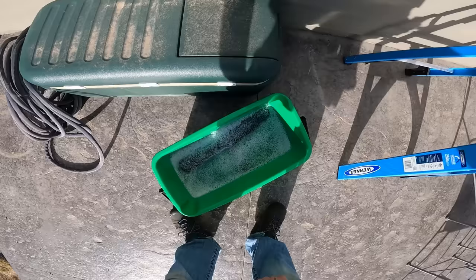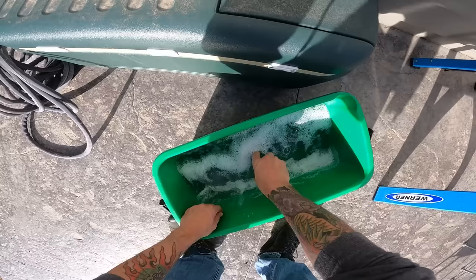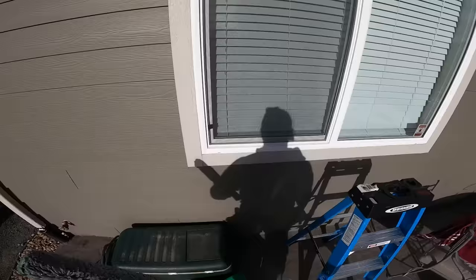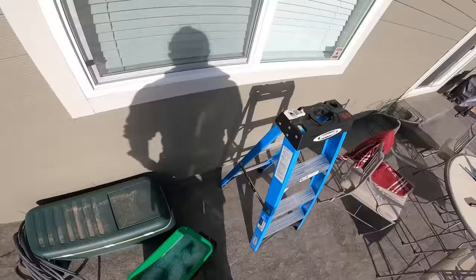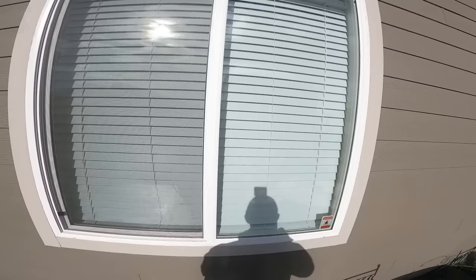For solution, I have simple dish soap and water — very basic to use when starting out as a newbie. In about three gallons I've got about a good five-second pour of soap, which is perfect. Put your soap in, mix your mop a little bit to work the soap in, run it through the mop and you're good to go. It doesn't need to be crazy soaking, but when we're in the sun you want it pretty wet overall.